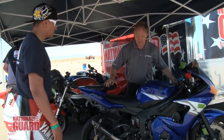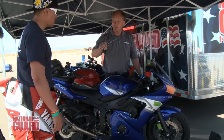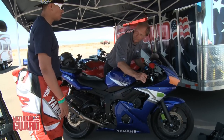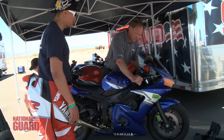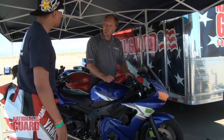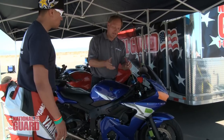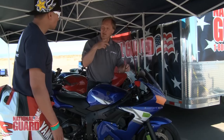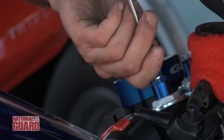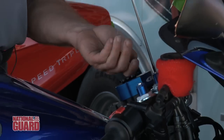What I'm going to do is take the front end and bounce it. What you should see is that I depress it, it comes up, and then it stops completely. With just the return stroke it should not continue to bounce. You can see you're basically on a trampoline, which is very standard in terms of how stock forks come from the showroom. This is the control for rebound — in essence it's basically a valve. Oil is going around unchecked right now, so we need to shut it down so it doesn't keep bouncing. We'll take it all the way in and come back three clicks.